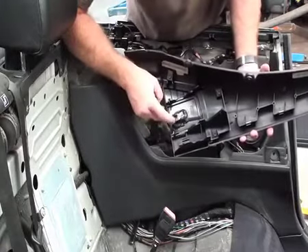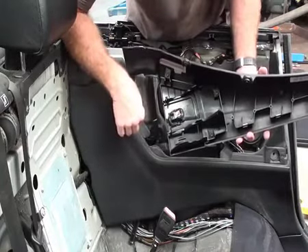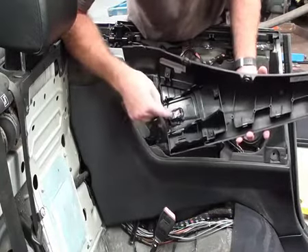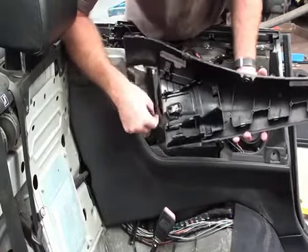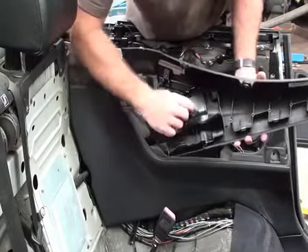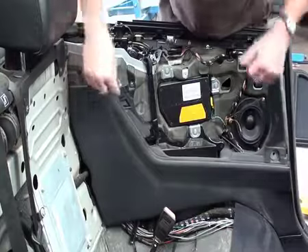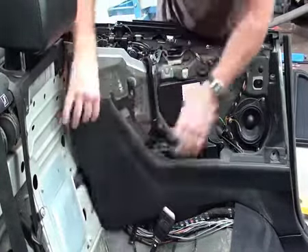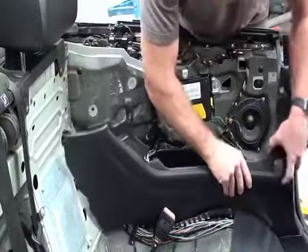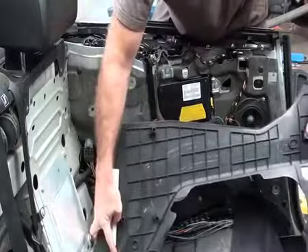I've done a fix on mine because the little plastic piece in here often breaks out just due to the forces on it. I've actually put a piece of aluminum in there, drilled a little hole in it and glued it in fairly solidly so they can just pull back and forth and it's never going to break anymore. The last thing that needs to come out so you get access to the convertible module, which is down in here, is this — it just pulls off with a couple of clips, and once I unclip that it just pops off.